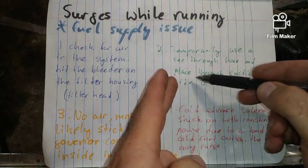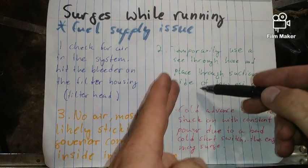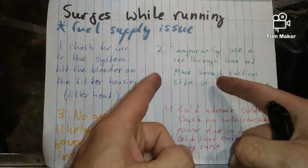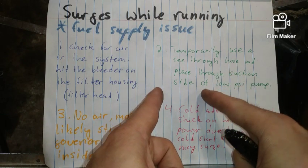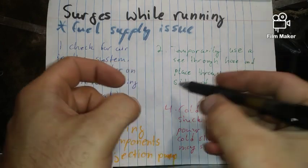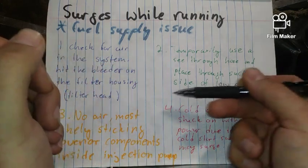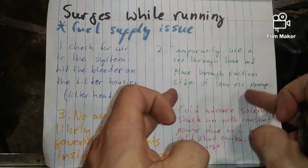If you have aeration or bubbles coming up to the housing, then what you could do is find those little rubber hoses, and you can slide them off, and then you temporarily take a clear hose, and you will temporarily slide it on, and you will observe the air bubbles coming through. If there are air bubbles going through the line, then that means your leak is farther closer towards the gas tank. This is a pain to do, but it's how you find leaks.